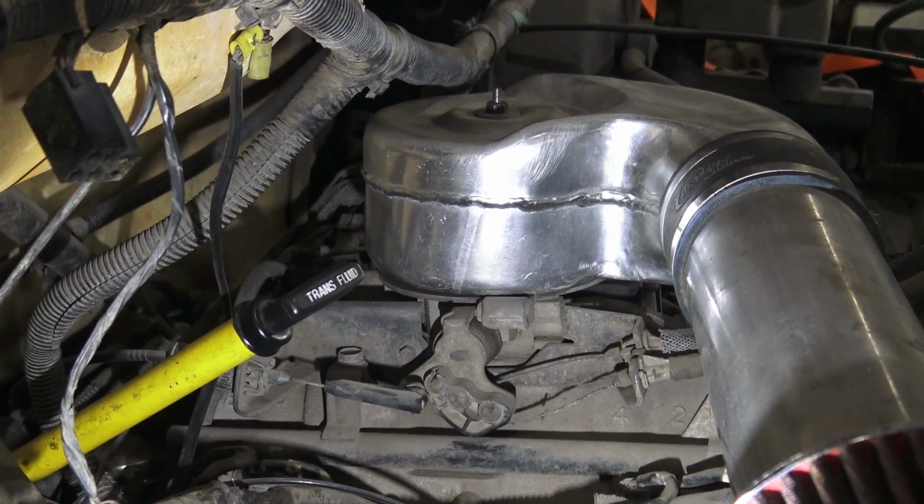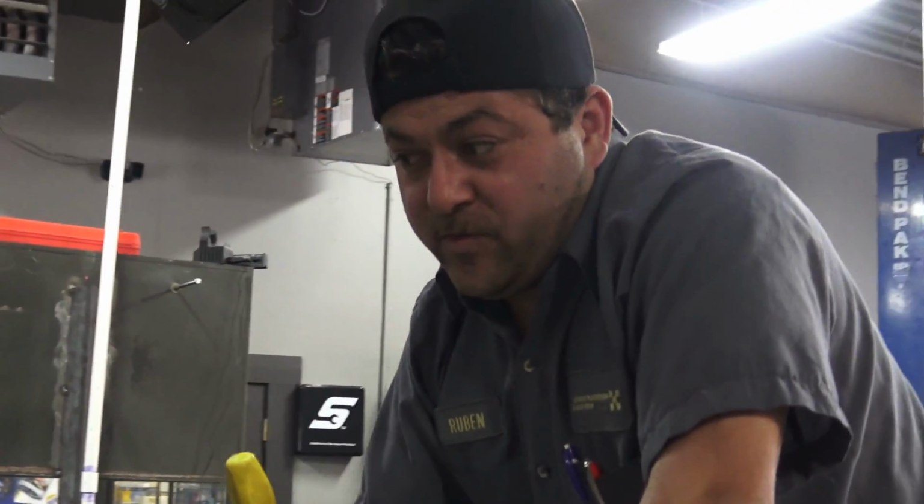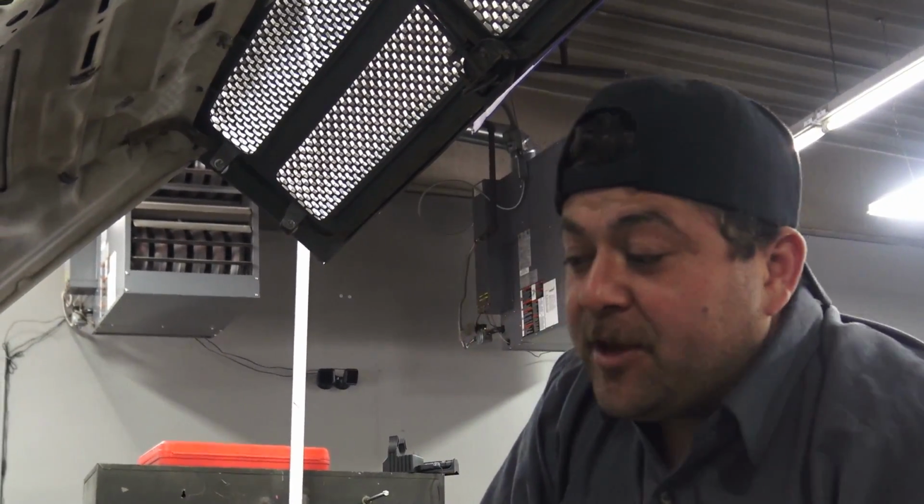Do you know at what RPM the torque converter will shift? Well, with the high stall torque converter, basically it'll have you start up quicker. It's not going to change any of the shifting points on the transmission. Oh, it won't go higher into the RPM band? No. What the high stall does is allow the engine to reach a higher RPM quicker, so it gets you to the peak horsepower and torque the engine makes. Okay, so each gear goes faster.